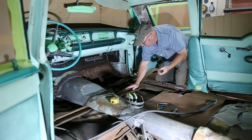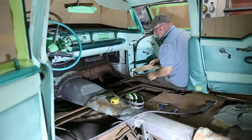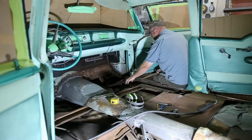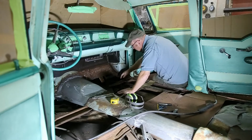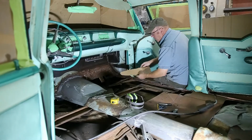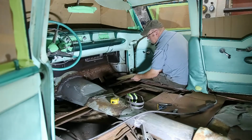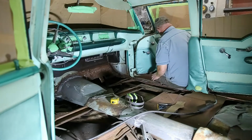Well, things must be getting pretty boring by now, but we're getting there. Now, I'm just going to show you what I do. I got this little brace here, or a support, and we got to tack it all the way around. I just made a pattern, and then took some measurements, laid it on top so I know where to drill some holes here so we can weld her up.